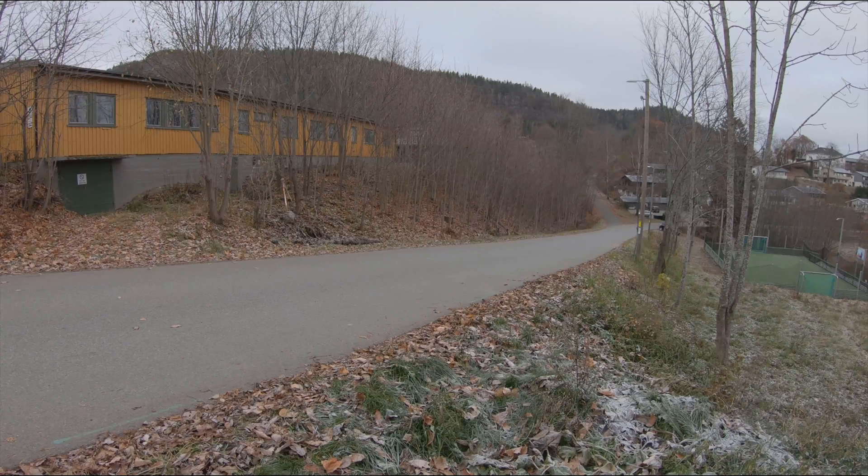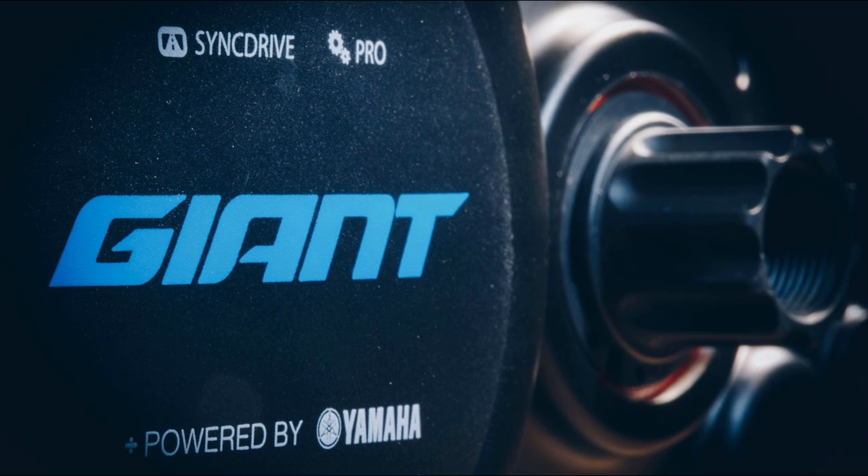I've always done an uphill test in my motor reviews, but this test is getting a bit meaningless. All of the new top of the line EMTB motors push the bike up to about 24 km/h, where the motor ramps down before reaching the 25 km/h cutoff speed. So I found a different hill this time and tried riding up at low cadence. The motor got up without losing speed in the 38-to-17 ratio. It's a benchmark for future tests, and I'm confident it's a good result because the 2020 Sync Drive Pro is still a great motor at low pedaling frequencies.